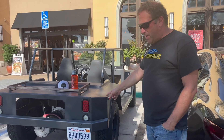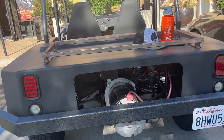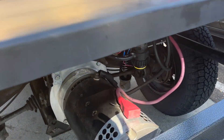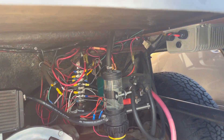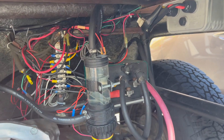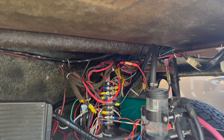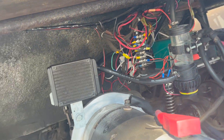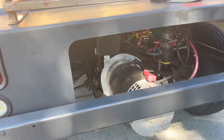We could start in the back since there's a big DC motor in here — like a forklift motor. I think it's an Advanced DC 1401. Next to it you'll see part of the controller. It's a Zilla controller, 1,000 amp. This is the third or fourth iteration of controllers in here. This one's water-cooled, so there's a little pump and a radiator to dissipate the heat off the controller.